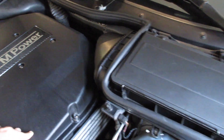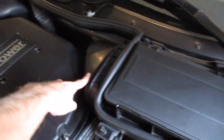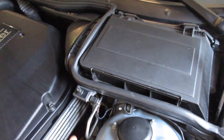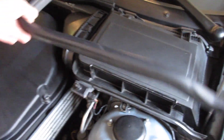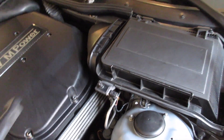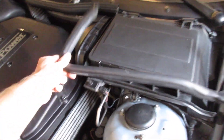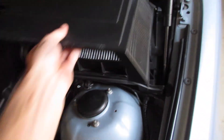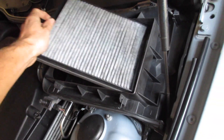To make things a little bit easier, we are going to remove the air boxes and the hoses going into the firewall. So let's start off on the driver's side. Pick up this trim — I've probably done this DIY ten times on how to remove these boxes, but there's always people that ask, so we're going to do it again. Just lift up on that trim, put it out of the way, open up this little door and remove it. Take out your filter and put it aside.